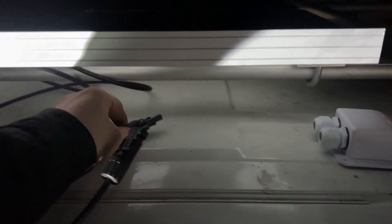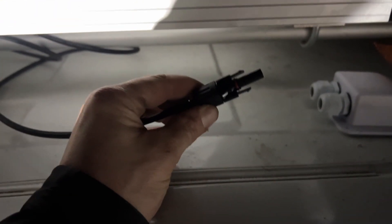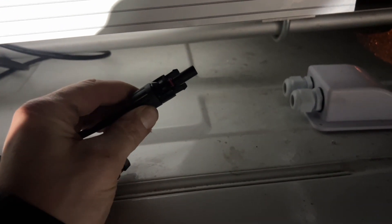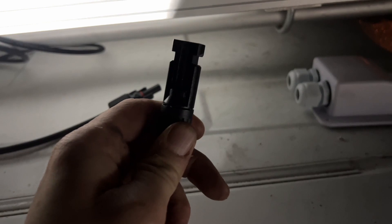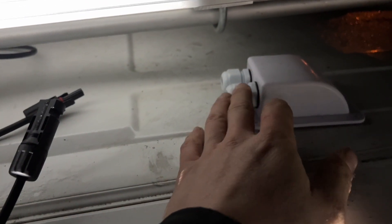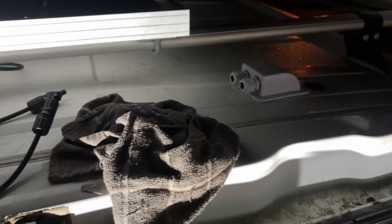For the avoidance of doubt, the positive wire on the solar panel is the male connector — so naturally, the cable running from the van will have a female end on it. The negative connection on my solar panel is the female connector, so naturally the cable coming out of this gland will be the male connector. Just make sure you get it right. I've already drilled a hole in my roof, so I'm going to seal that up now, put my cable through, and connect it all up.